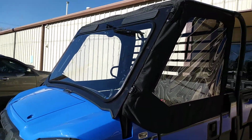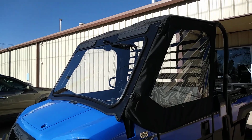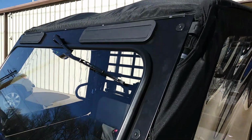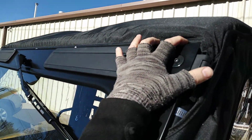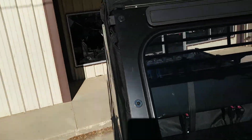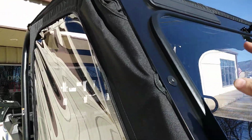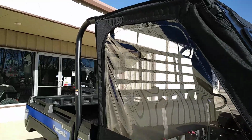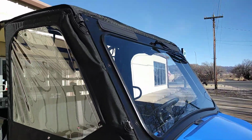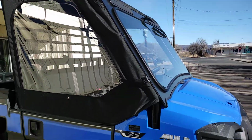I have an unbelievable amount of phone calls on this because, like I say in a lot of my other videos, Kawasaki does not say that you can do this, but it's really, really simple. So I'm going to show you guys how we do this. Right here on the top of the frame is a lip, and all you do is just drill that right to the aluminum windshield. Really simple setup. So you still get your seal all the way from the windshield all the way back. Now, a lot of them you see that we have a hard top on. That's real simple. Once you put the top on, you just bolt the hard top and the soft top together to the roll cage. Real simple, isn't it? Nothing difficult. It's all really simple setup.